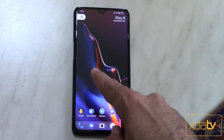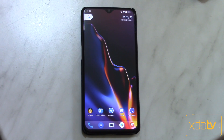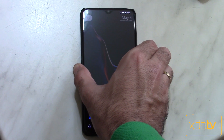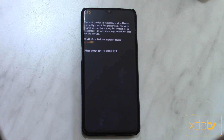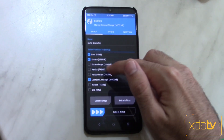So this is the phone — this is the OnePlus 6T, although M. Wilke states that the Renovate Ice ROM works as well on the OnePlus 6. To install the Renovate Ice ROM for the first time, let's go ahead and reboot to TWRP. Do keep in mind that I have my bootloader unlocked and TWRP already installed.